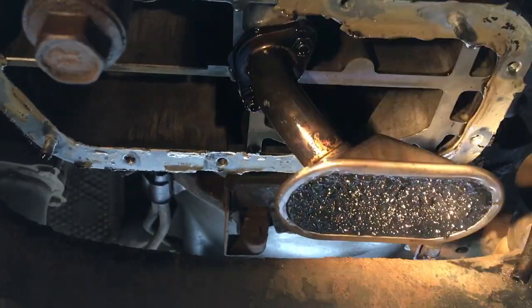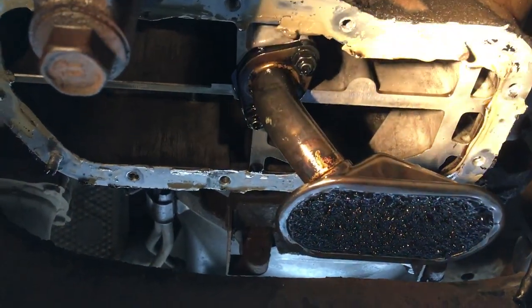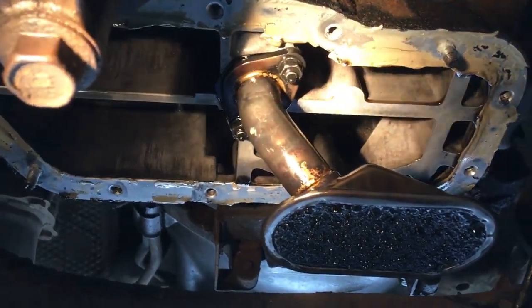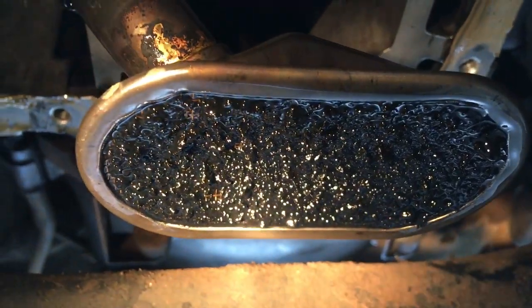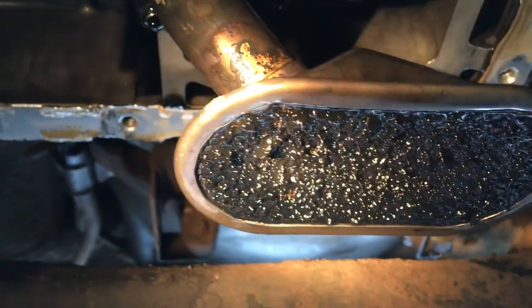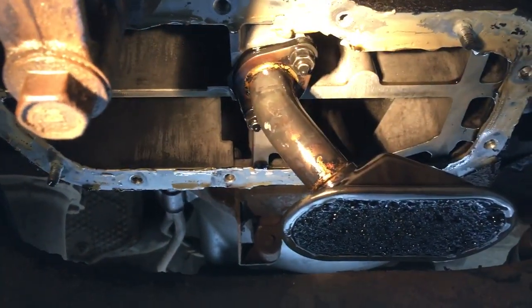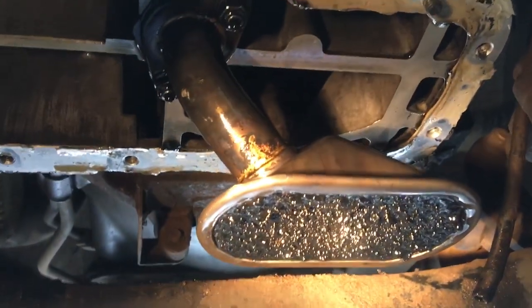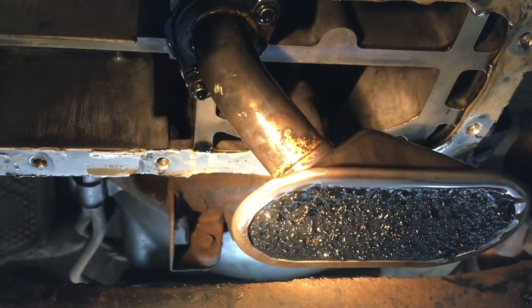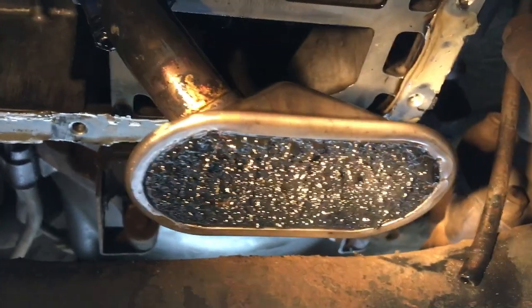This is what you do when you find it blocked — you need to remove it to clean it. This is on a Prado; you can easily remove the sump sub-assembly, there's only about a dozen 10mm bolts. Have a close look at that — it is definitely blocked, quite badly, almost a hundred percent. That could be a reason why this engine was having some noises and stuff going on. It was checked, but obviously it wasn't checked accurately.